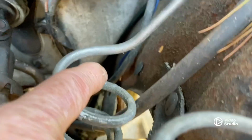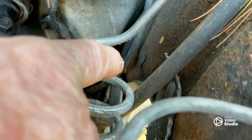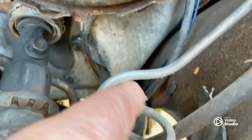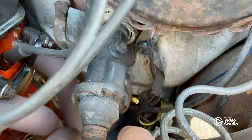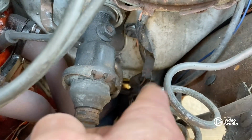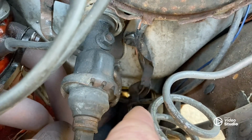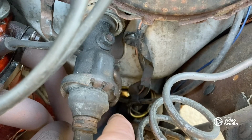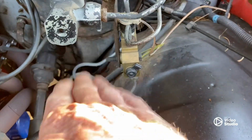Another guy commented it was his speedo cable. So I can get you down in there, sitting right, wait a minute, no, it's sitting right there, laying up against the header. Well, there's a little clamp down there that holds that speedo cable up. You need to make sure you got that in that loop as tight as you can get it, and pull as much slack as you can from up here, and keep it up against the bottom of that cab.